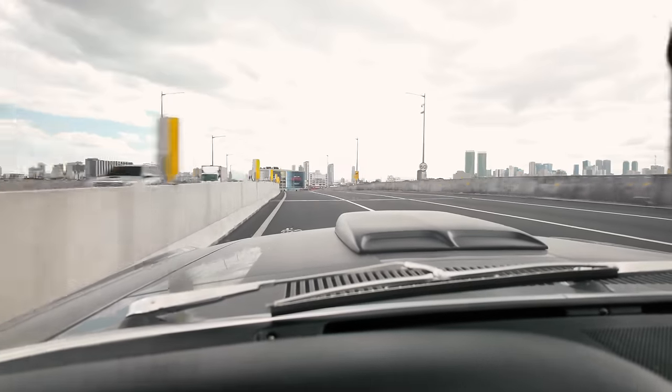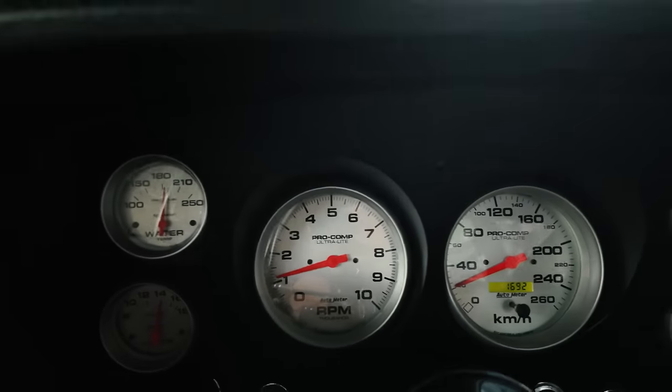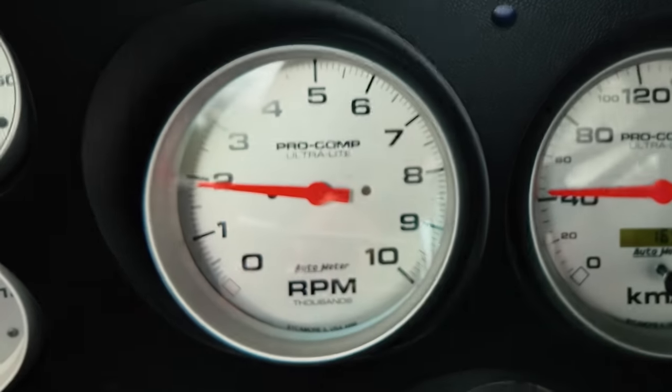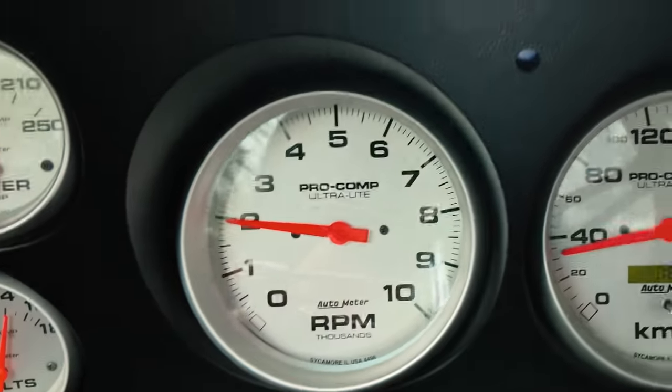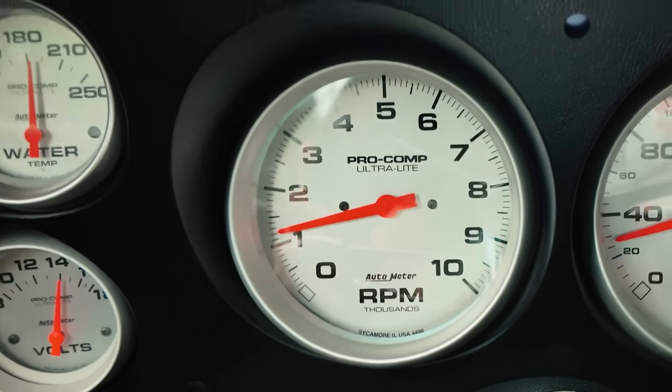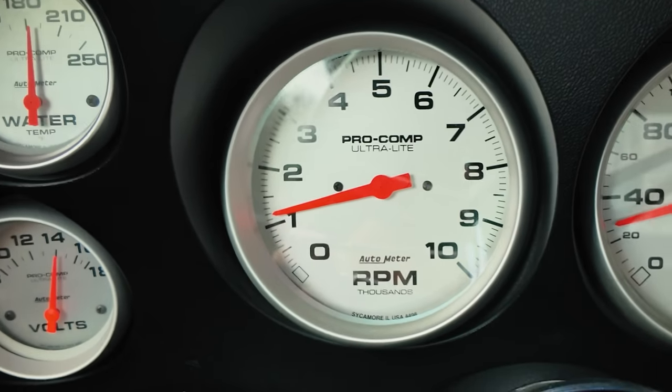It's not the fastest, but for an old car, it's amazing. There's a slight rev hang, or it drops down. Gonna rev hang from third gear stop. There it is. Rev hanging, and then it drops down. So I wonder if that's overfueling.